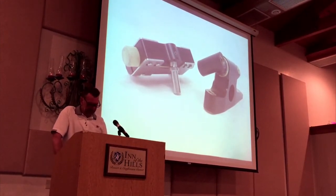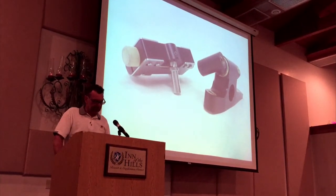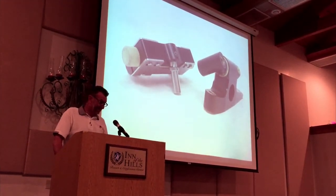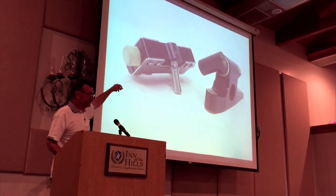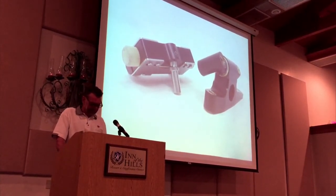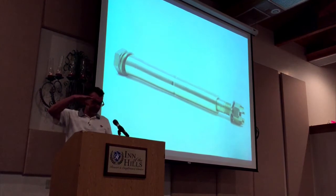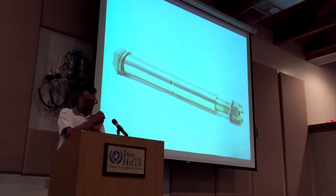The mating part for that — these are made of better materials and offer a longer life of the part. The steering horn, the part on the left, shows a wood dowel in it and that simulates the aircraft airframe that it's clamped to. The next thing that you'll see a lot of — and I know Carrie could back this up — is the aircraft's jacked up and you take the nose wheel and you get fore and aft play.